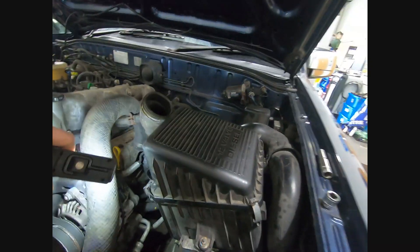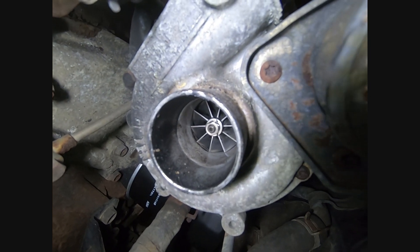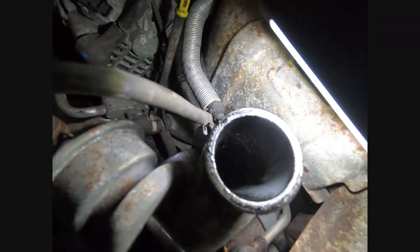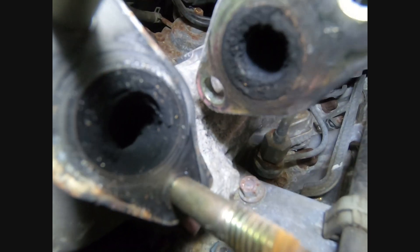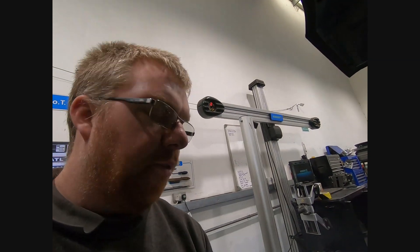And the other part is the turbo. So I've taken the turbo — if I slide you down there and try to get a good shot, hopefully inside the turbo — there we go. So that's inside the turbo on the intake side, and I've also got the outlet from the turbo; I've taken the intercooler hose off. You can see it's pretty — it's not too bad — it is kind of black inside there, again it's a bit oily as well, but as a whole it is quite clean. So this is the EGR side on the engine; you can see that there's actually a lot of carbon build up in there. And likewise on this part of the pipe — both of those pipes — you can see there's a fair amount of carbon build up in there, so it'll be really interesting to see just what difference it makes.